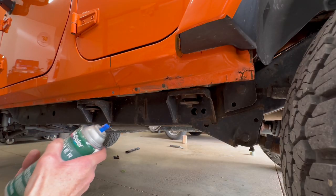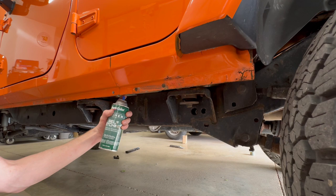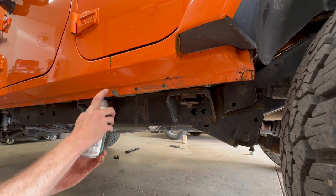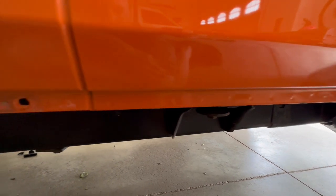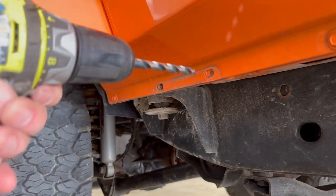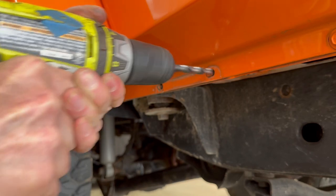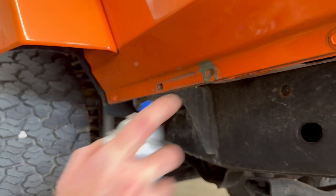Now I'm gonna spray the bare metal with some self-etching primer, and that will help prevent it from rusting. I'll put a link to this in the description, as well as any other special tools needed for this install. While the primer dries, I need to move up front and modify this second hole by drilling it out to 21/64 inch. And spray this one with the etching primer as well, so it doesn't rust.